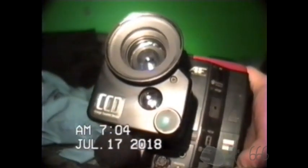Here is the camcorder. You can see there is the infrared focusing system — all camcorders of this vintage pretty much used that if they had an autofocus system. You can see the microphone on the bottom; the foam is kind of falling apart but it is still there. There is no lens cap. The autofocus doesn't do a whole lot because these older camcorders were really more intended for far-away shooting as opposed to close-ups. They have a macro mode, but it is not a very good macro mode, and for a lot of things you have to use it in order for it to work.